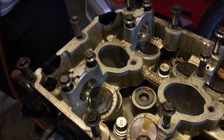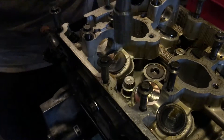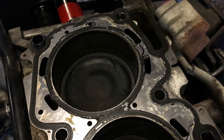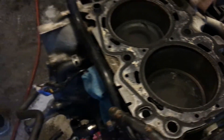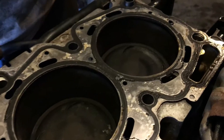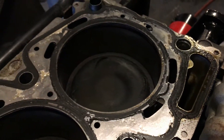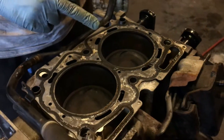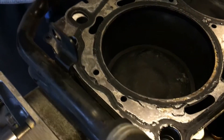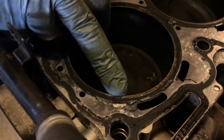These definitely don't have even torque — could be why the head gasket blew. Right there, that's where it blew — see all the black stuff. That'll do it. But the oil was an internal leak, obviously that's why we're doing this. You can see the oil galley does not have it — still has gasket material around it. That's why the engine's not trash, because it didn't get coolant into the oil. But clearly it was getting out past the piston and into the cooling jacket right there. That might be the only place in this entire engine where it failed.